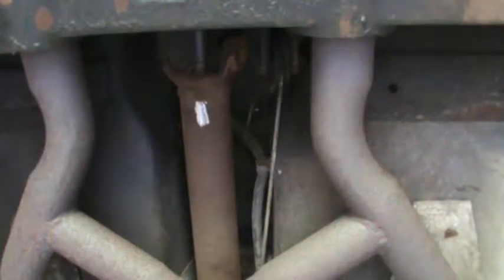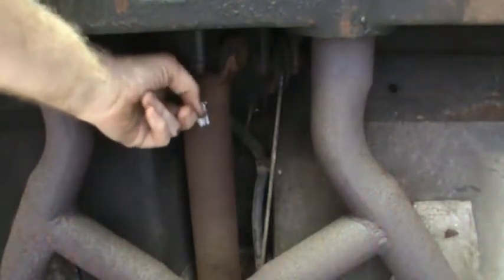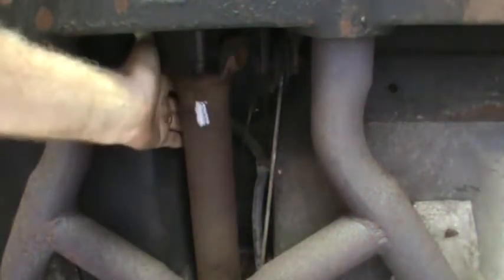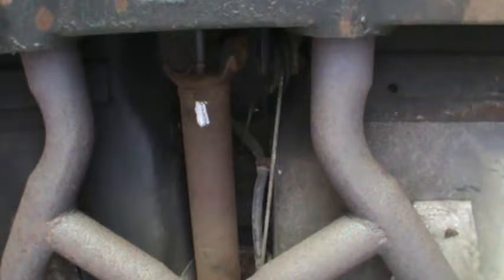So I'm going to set that up and I'll be back in a minute. What I failed to mention before is that right above this mark on the top of the driveshaft, there is a balance weight, so I'll have actually two reference points that I can use after I've turned the wheel one revolution.